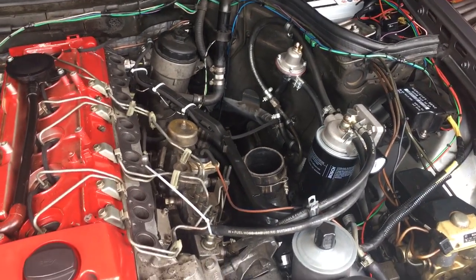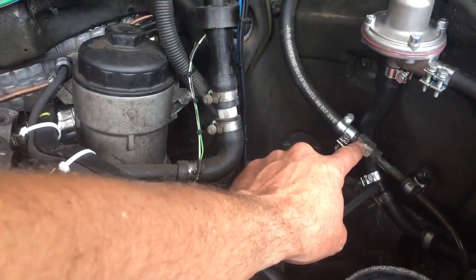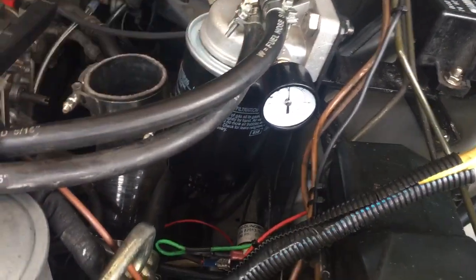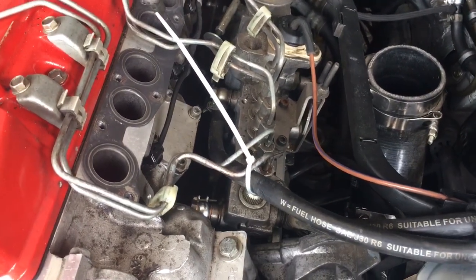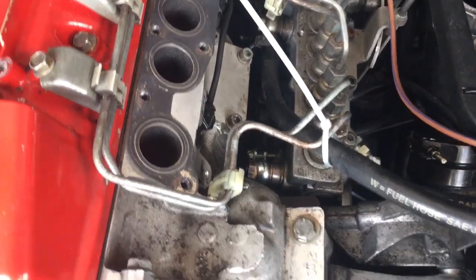So this is the plan and this is how I'm expecting it to work. High pressure fuel from here, from the Bosch 44 hard line down there, all the way around and into this new filter head — a massive thing with a pressure gauge on the side — which goes to either end of the fuel pumps. It's one of the old twin-entry jobs, and the return banjo is there; that one has been drilled out.